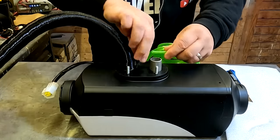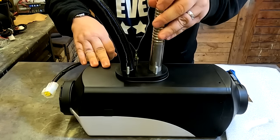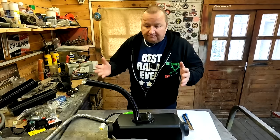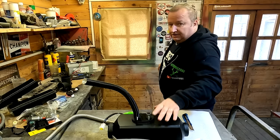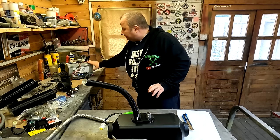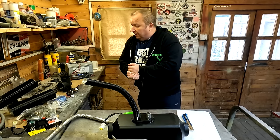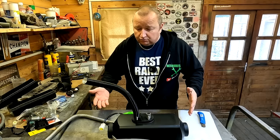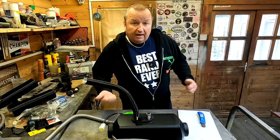You've got to have the air filters on because apparently without them it can be quite noisy. That will obviously be the fuel line, and then the exhaust line — which will be a metal one — goes on the furthest away from the fuel input. I plan to fit this in my log cabin, possibly fitting the unit on the outside on a little shelf. You also need a 12 volt supply — that's why I've got a battery here, which I've had on charge for the past day. Everything should be here to set this up, so I'll rig it up in here first and have a little test before putting it in its final location.